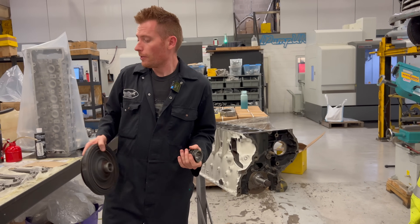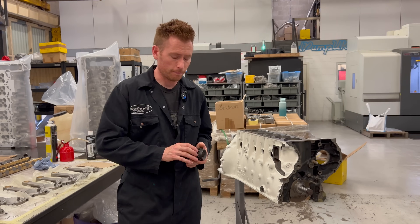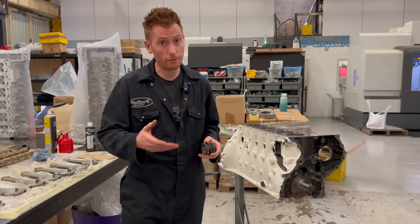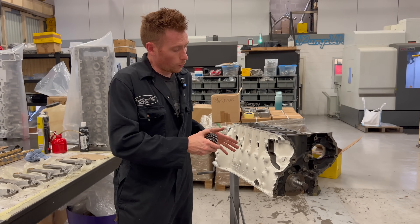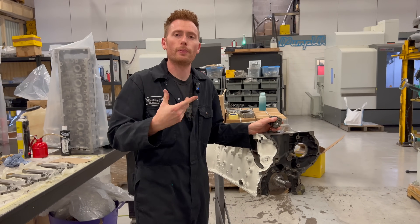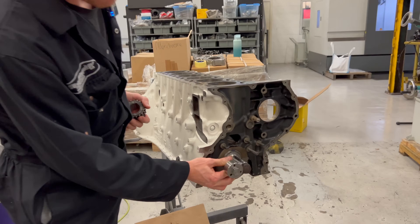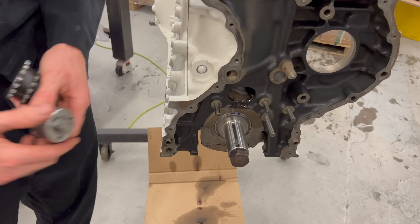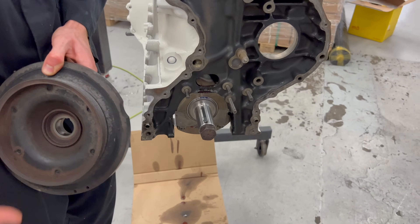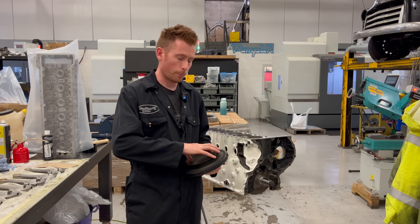It's the friction and tension holding these together that really stops everything from rotating. However, because we're pushing higher revs and putting more harmonic stress on the engine, and using flywheel combinations Mercedes probably didn't consider when designing their original pulley, we're having issues with the front pulley coming loose. I covered this in my old video on how to build a 700 horsepower 606 — where you use a jig to drill the pulley and crankshaft simultaneously and insert a locating peg.